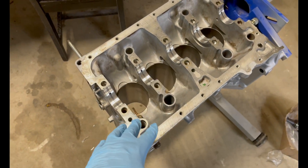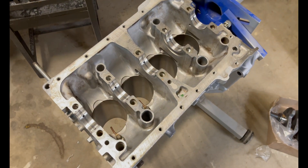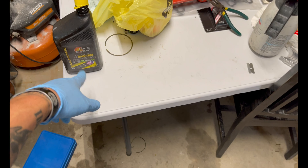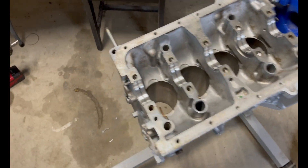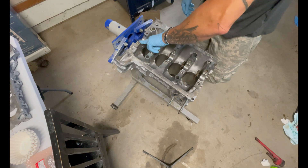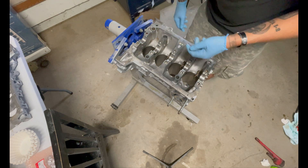I want to do it with regular motor oil because I don't want to use that thick assembly oil when I'm checking with the plastigauge. I'm just going to get a light coat on it — just cheap stuff. Let's check the gapping on everything. First time this motor's probably seen fresh oil in 15 years.